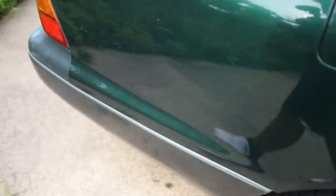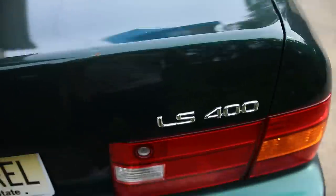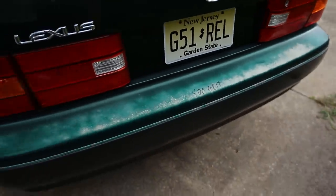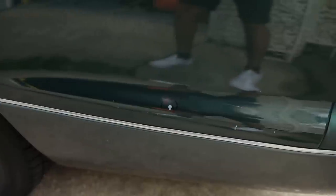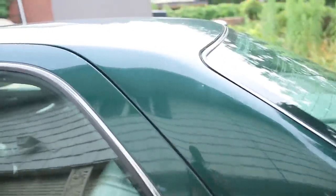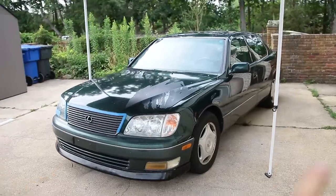You can get the picture — Sharpie marks here, and then a tiny little dent there that I'm probably not going to worry about. I'm going to sand down this a little bit here. 400 grit on the back bumper here to sand this down. This DIY botched rear paint job with a spray can came out terrible — the previous owner did it. We got another spot marked right here, so we're going to go around the car and sand down all the little and big imperfections.